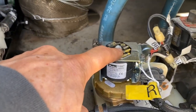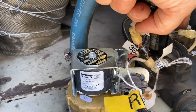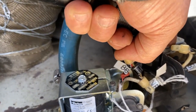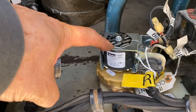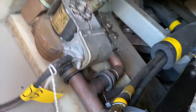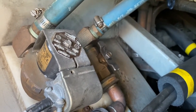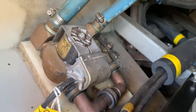This valve is for engine heat and this valve is for coolant. This valve here comes on when you turn your ignition key on — it is normally open and it will shut. This valve is normally closed; when you turn the Webasto on, this valve will open. This valve is the driver's side solenoid, and when you turn your Webasto on, that valve will open as well. Over here there's the driver's side solenoid and right next to it is a Parker Hannifin open-and-close valve for the line, which is like a return coming back from the system.